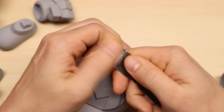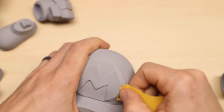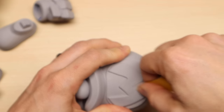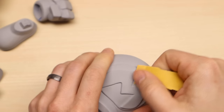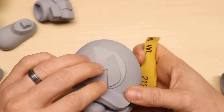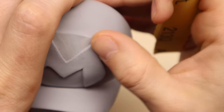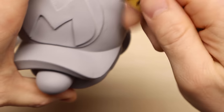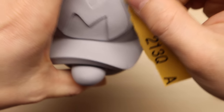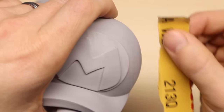And we can see that we've got some dust and already some buildup on there. So we're just going to keep doing this until it really fills up right there. Now, the reason why you don't want to go with a very low grit sandpaper is that we don't want to be scratching into this primer. If you see already, this is super smooth because we're really just polishing this paint, and this is going to get it nice and smooth without removing a ton. We're relying on that filler to fill in all those cracks, and we're just removing any excess.